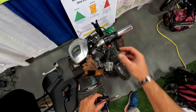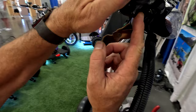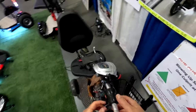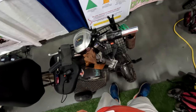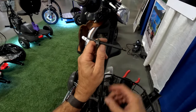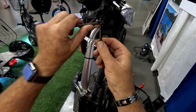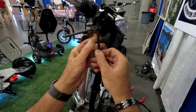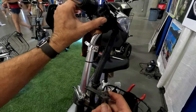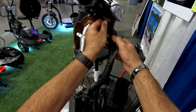My next step is there's a little set screw under here. A set screw, folks, is a little screw that - I don't know if you can see this, my camera work - where my finger is, it's an allen screw. It just holds this in place. I'm going to loosen that. No one's allowed to laugh at me because somebody took his allen key set out of his toolbox and did not put it back. Luckily I had this driver bit. You can see where the set screw is. I loosen that - see how now it slides and turns?